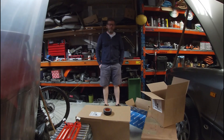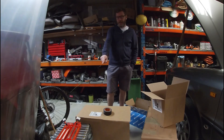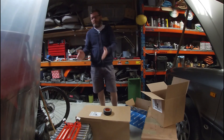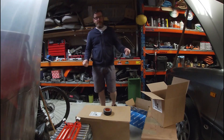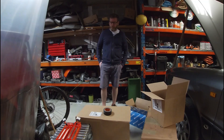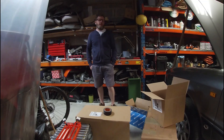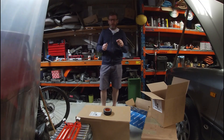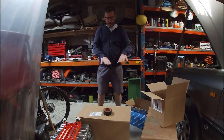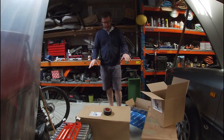What I want to do is build a box out of cardboard in the shape of that battery there, so you can easily make a template. Then jack up the car, see if it fits in place, and be realistic about what needs to be done. A little bit of the chassis might need to be cut out because the shape of the petrol tank was very curvy, not very square.